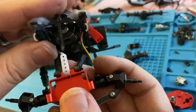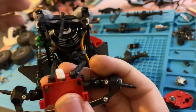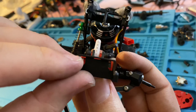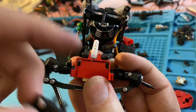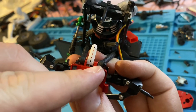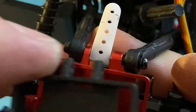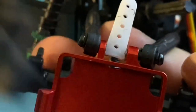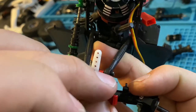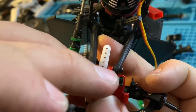We've got it mounted up. It works. We'll be able to mount our limiting strap to that. However, something about this aftermarket tray — if you notice, on the stock tray the mounting points are equal. This tray isn't designed for four-link, neither is the original mounting tray, but we're going to make it work. You can see this side is thicker and rounded — that's the side the threading goes into. When you're using a Y-link, we're going to have to trim this down so they're equal, otherwise the whole thing is offset. There's also not a lot of movement, so it's binding because of the curve. So we're going to customize this a little.